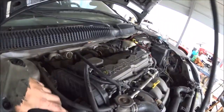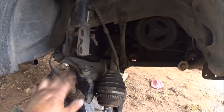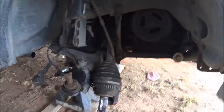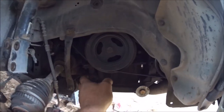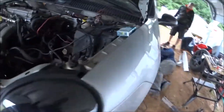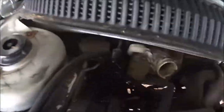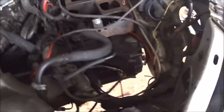We're tearing this apart. We pulled both spindles — we did find some issues with the spindles so we're addressing those now. Usually we just pull them and lay them to the side so your axles are out of the way. We're going to undo the motor mount and the center mount — this one has a solid center mount. We're going to string a chain from the alternator nut across the top and support it with the engine crane.